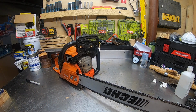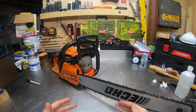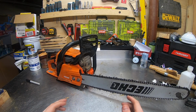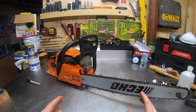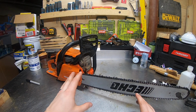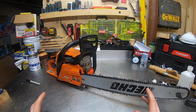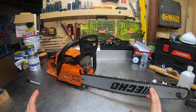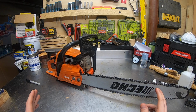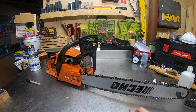I'm always doing fun stuff around here. So anyways, this is my 5-year review on the Echo CS-490. You do those three things to it, I think you have a saw that can compete with the bigger brands. Right out of the box, no, I'll say it flat out. But if you mod the muffler, retune the carb, change the chain, I think you got a pretty powerful saw for all around good home use. Would I take this out on a wildland fire? Probably not. But for what your average person is going to use it for, I think it's a great saw.